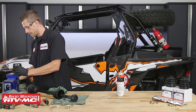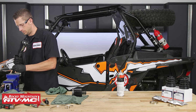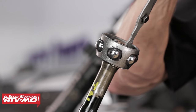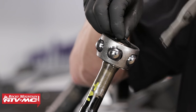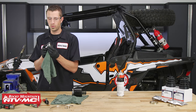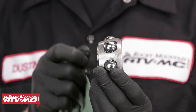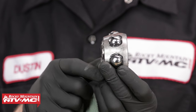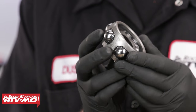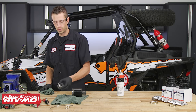Remove the plunging joint from the vise, then place your axle back into the vise and wipe off excess grease. Next, there's a snap ring that retains the racing cage onto the shaft. Take your snap ring pliers, remove the snap ring, then remove the racing cage. There is an orientation to this assembly: the larger diameter faces towards the inboard part of the axle, while the smaller diameter faces towards the outboard joint. Polaris does not recommend disassembling the racing cage any further, as these parts develop specific characteristics as they wear.